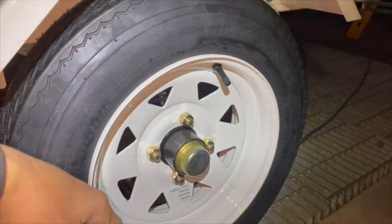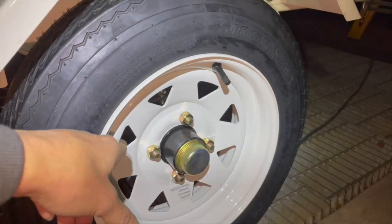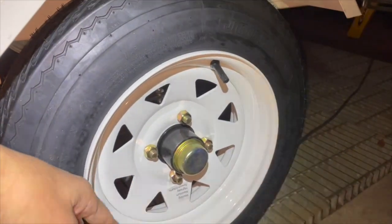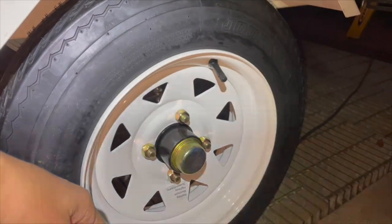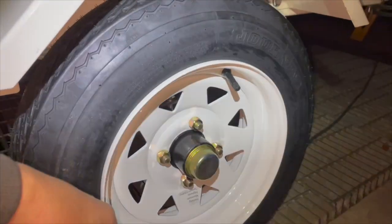That's way too low. If you start driving like that without torquing this thing down first, you'll lose your lug nuts. The lug nuts will get undone. So, yeah, 75. Maybe I might bring it down to 70. But anyways,